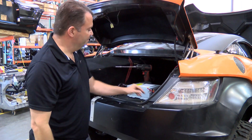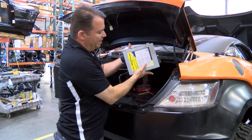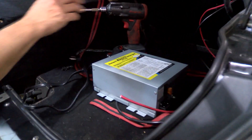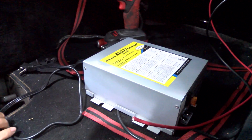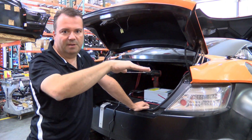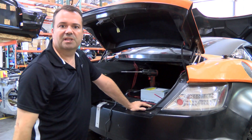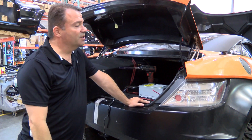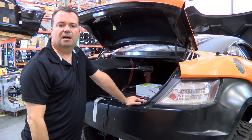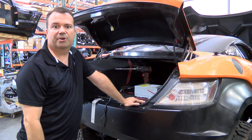So we're actually mounting this right now — a very large trickle charger that goes up to 35 amps, which can handle everything it's going to draw. But it's not going to keep powering it once it tops the battery off; it'll back down so we're not sitting there cooking the battery all day. This car is going to be shown at the IBM Impact show in Vegas on the 27th of this month through the 30th.